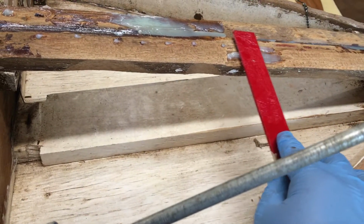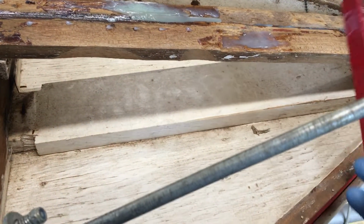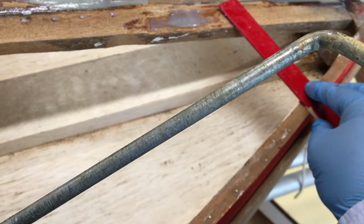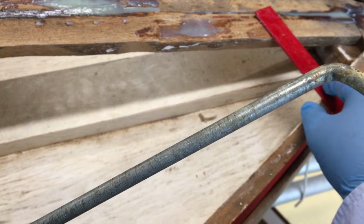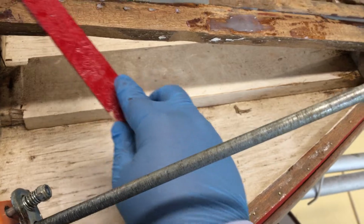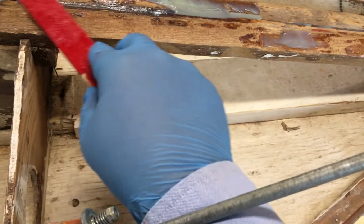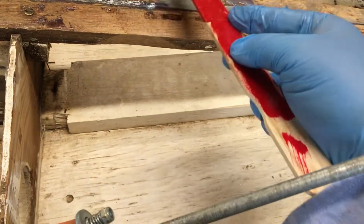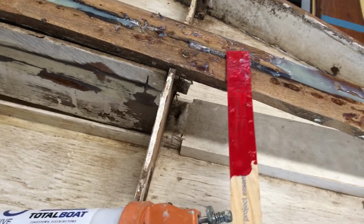Take it, run over it lightly with the paint stick. We're using this angle here that the plank's going to lay. And you just go down between the edge of the boat and the keel there. There's a piece of plywood that's going to lay on that. So we'll just go in and knock down the tops of those so we don't have to do much sanding. And the boat will be ready for paint pretty soon.